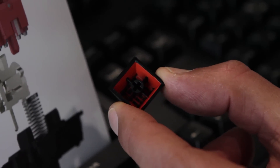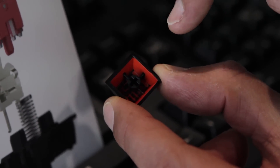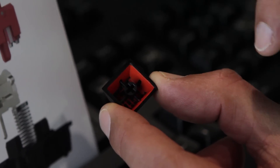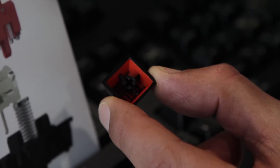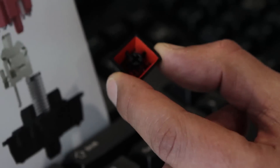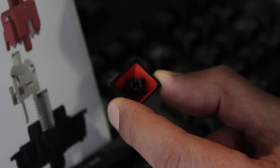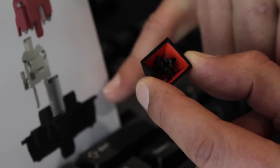So why did we develop the Cherry MX Silent Switch? Normally, what customers did — because mechanical keyboards are loud by default — is they put an O-ring between the keycap and the original switch. This gave us at Cherry a challenge, because the force when you hit a key is transferred to the top housing instead of the bottom housing, where it's supposed to be.